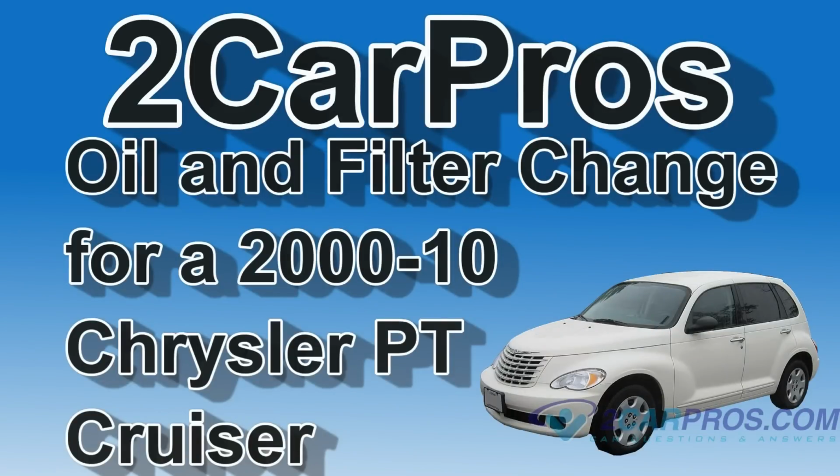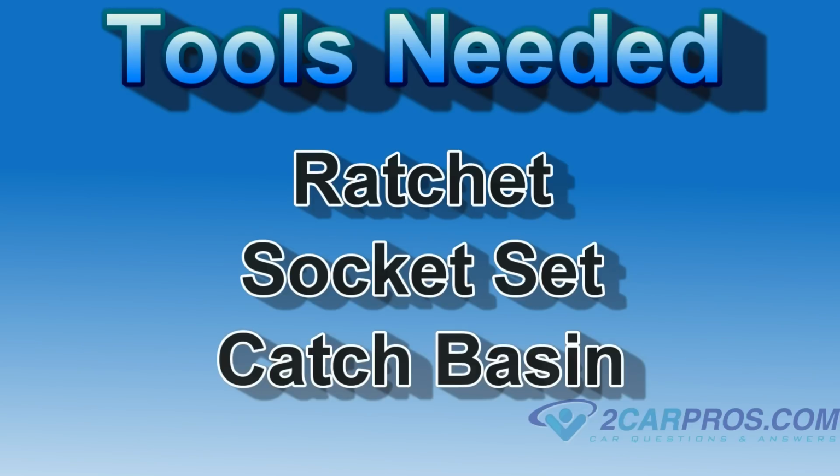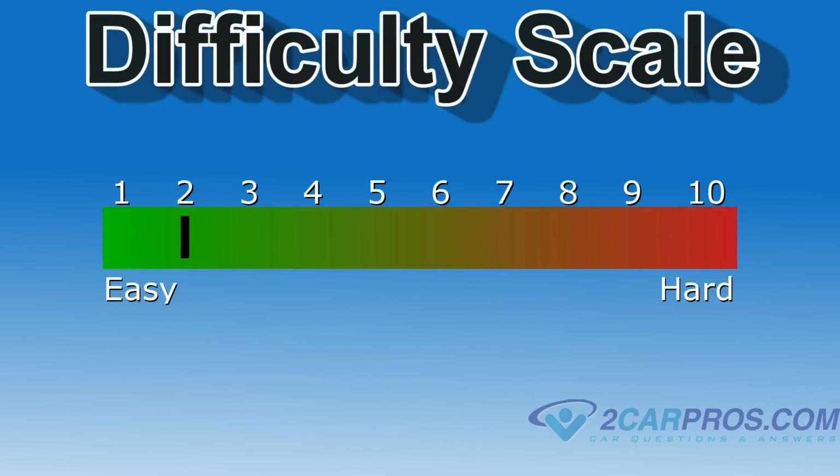Today we're going to show you how to change the oil and filter for a 2000-2010 Chrysler PT Cruiser. The tools you're going to need are a ratchet, socket set, and a catch basin. This repair is rated a 2 out of 10 on the difficulty scale.